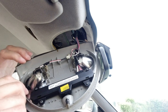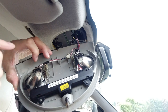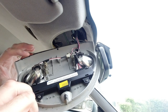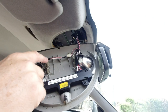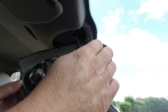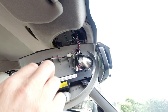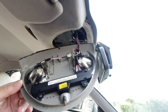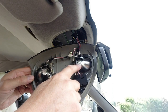On the back of here, what we've got is three metal clips: one right at the back edge, and two much burlier ones at the front. The reason you want to be working at the windscreen end rather than the back end is those front ones are quite strong — you want to be working them, not detaching the rather weak rear one and then levering and working the plastic rather than the clip. So pull it from the windscreen end.